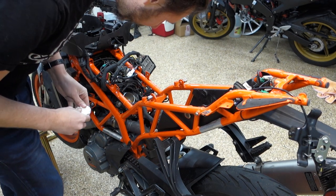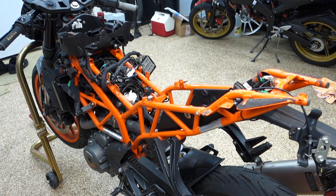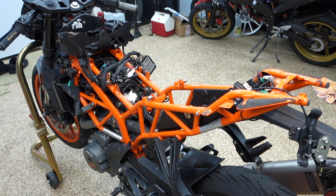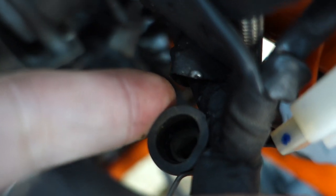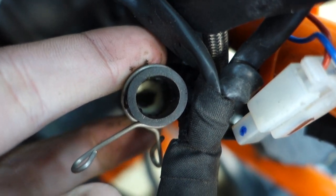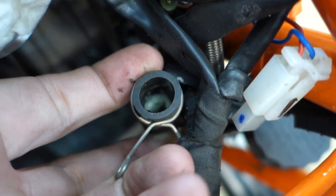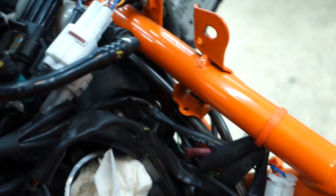Block that intake off with paper towel real quick. Especially because there's a lot of liquid around here, especially coming out of this line, which I really want to trace, see where that comes from. So it's going into the airbox from... the lower portion of that connection on the airbox was a line that's actually coming from, it looks like, the crankcase. Yeah, so this is the lower line. I don't know if it shows up on camera, but it's absolutely filled with that white fluid, or that foam. So it seems like it's getting pushed up through the crankcase, probably where our coolant was going, into the crankcase, getting, I don't know, turned into foam and then thrown up through the airbox. Out to see where this line here goes, because there's liquid coming out of that. But we'll worry about that when the engine's up.